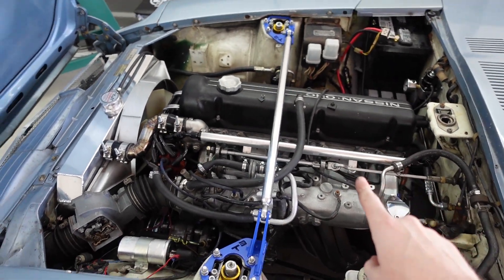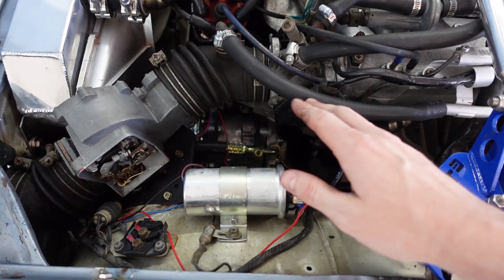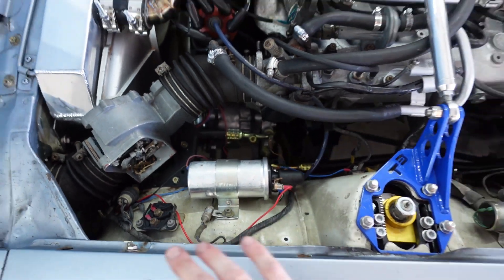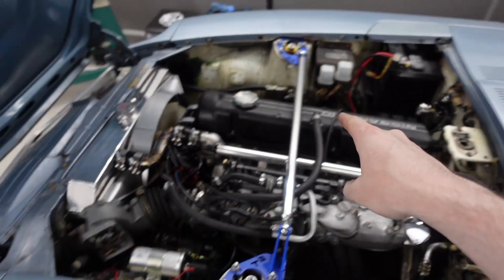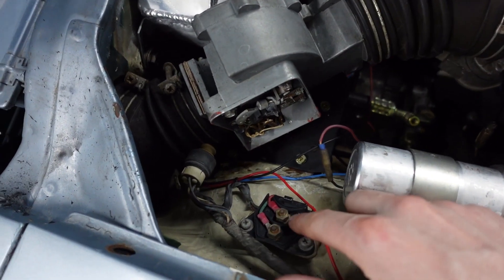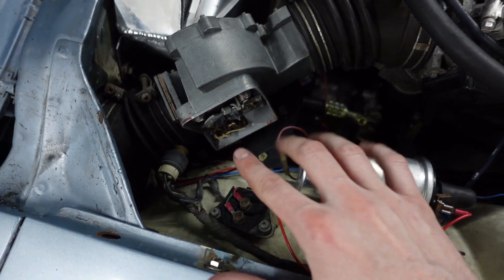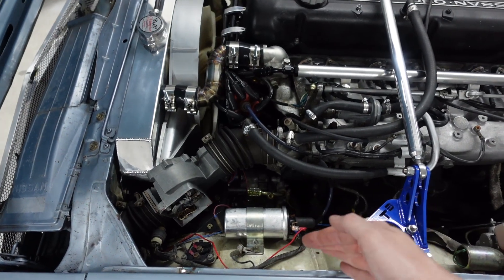Now that we've established the wires we've done are all good, we're gonna move on to the next step. The next step is making a wire for the ignition coil, which is not going to be much different than the others, but I'm also going to be repositioning the coil further down in the engine bay to help clean things up even more. If you're gonna do the same thing, go ahead and unplug your battery first before messing with the ignition coil. And if you're a 280Z owner with a stock distributor, you need to keep the ballast resistor in the system. I have a different distributor — it's electronic, not the traditional kind — so I can remove the ballast resistor and be totally fine. I'm gonna take out the ignition coil, polish it up, and get ready to reposition it.